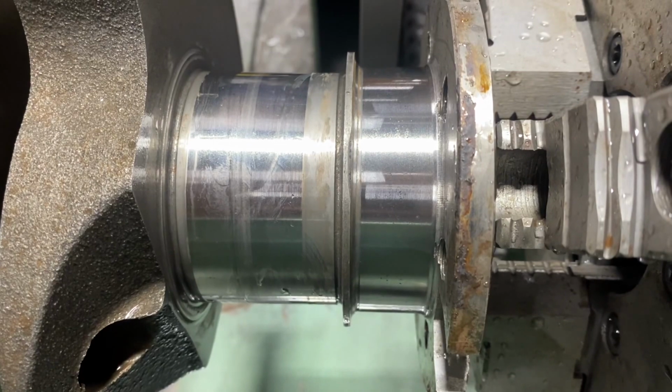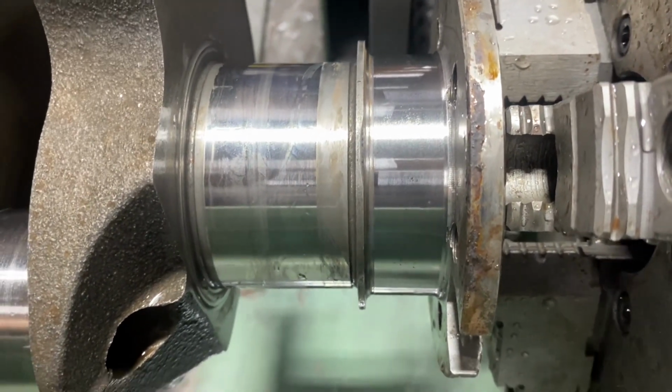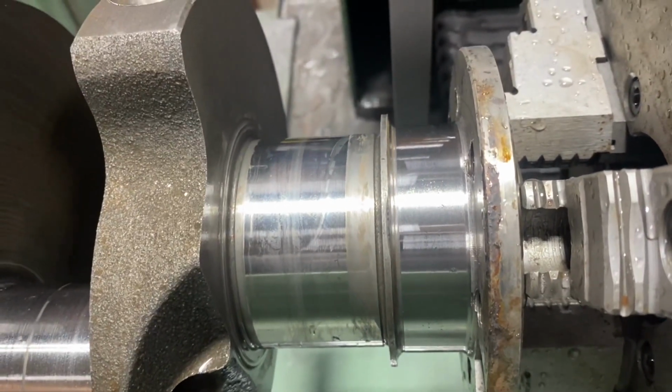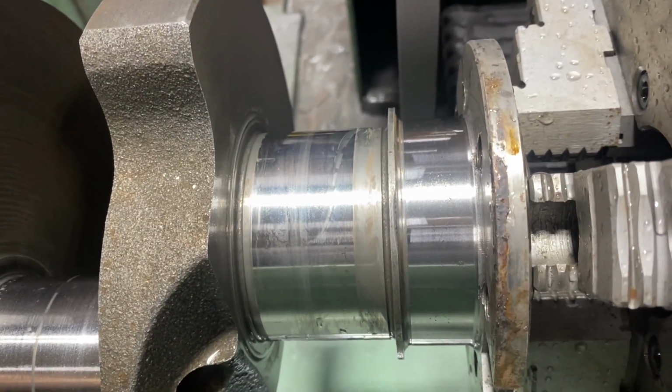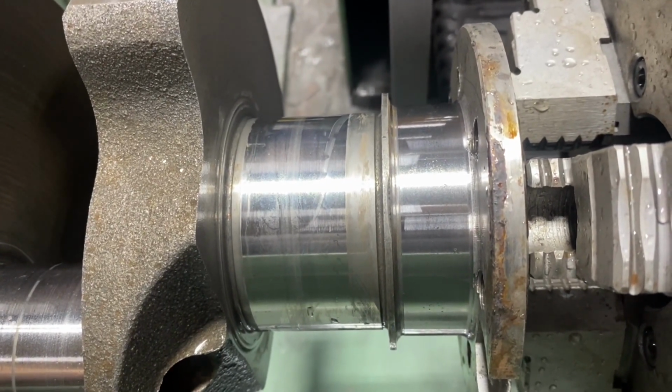318 you got to be careful. You can't do that because you can't buy, at least I haven't been able to find, a rear seal that's rubber that has no serration in it. So 318 opposite rotation, right hand, you got to use rope.